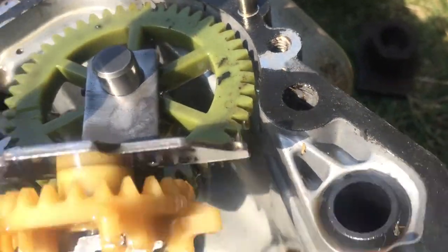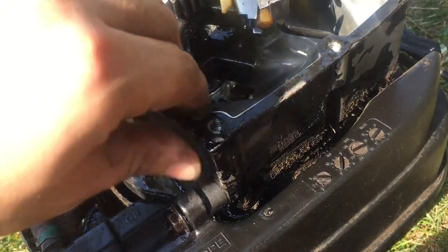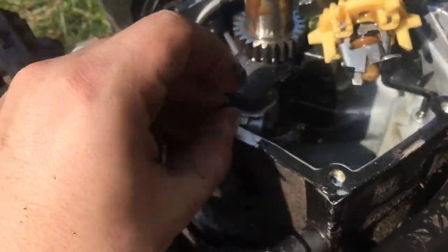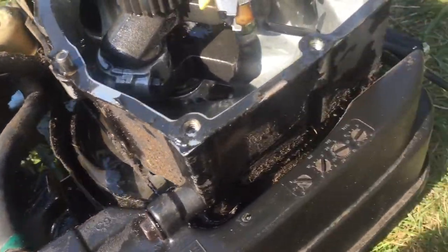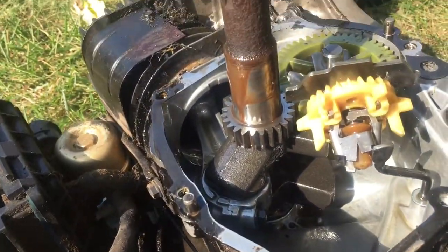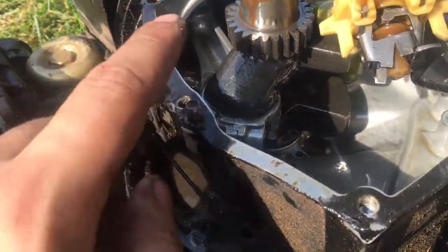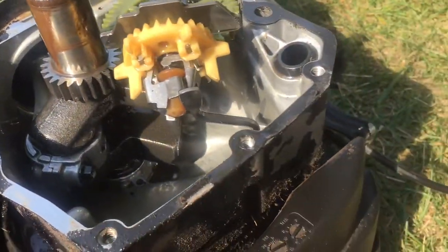And right there is another problem. So obviously this gasket is the reason I was having a leak on the front of the mower. So I'm gonna clean off this gasket right here and then probably in the next couple days order a replacement one and get this all fixed up. So the next thing I'm going to do in the meantime is clean off this gasket, clean this area, I don't know, probably clean all around here just while I already have this all set apart.